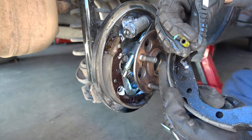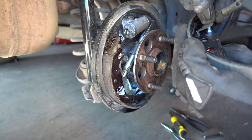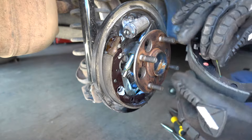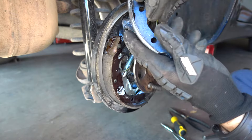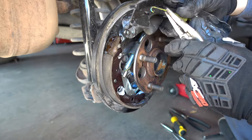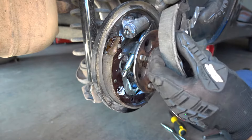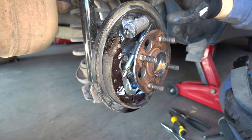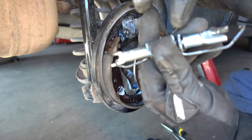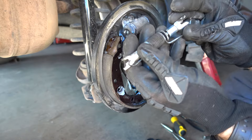The new piece has that little pin — remember I told you about the pin. So this one goes in there through the pin. And now this spring will have to go through this little hole over here, so I'm going to use the locking pliers again and run it through. This mechanism is very, very important — specifically designed for holding this. It catches on these teeth over here so you can adjust the brakes.